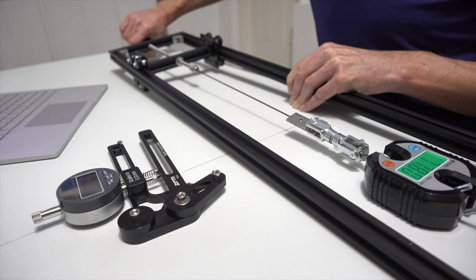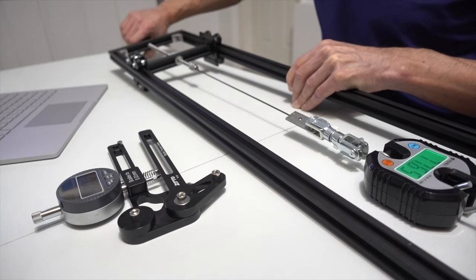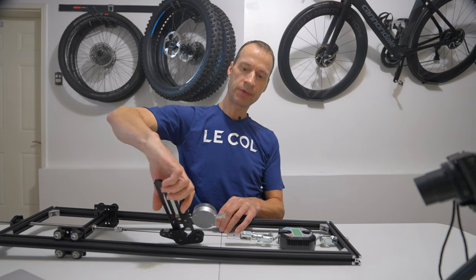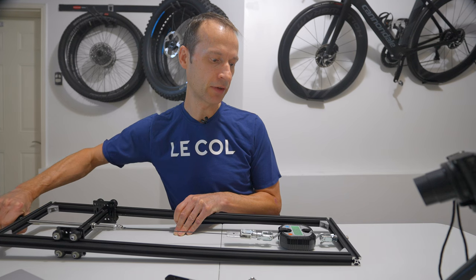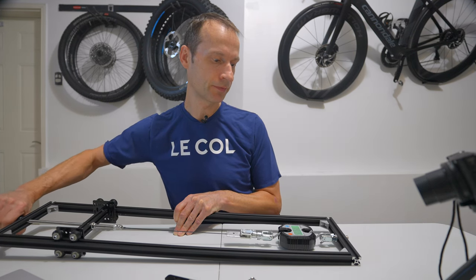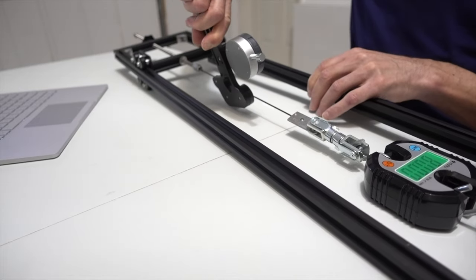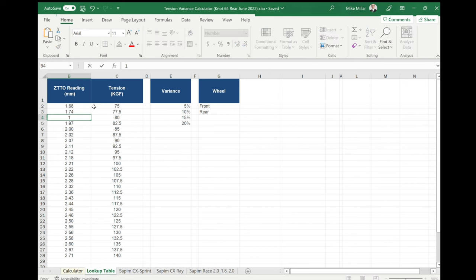So there we go at 75. This is a bladed spoke so I have to position the tension meter so that it fits along the flat portion. I'm measuring 1.68 millimeters of deflection, so I'll enter 1.68 into my spreadsheet — that's 1.68 millimeters of deflection measured by the spoke tension meter, which equates to 75 kilograms of force. Then I go up by 2.5 kilogram of force increments, so now I'll go to 77.5 kilograms of force. Getting to 77.65 — that's probably as close as I'll get it. I take another reading and I'm getting 1.74, so I enter 1.74 for 77.5 kilograms of force. Then 80 — bang on 80 — and I'm getting 1.76, which I enter for 80 kilograms of force.